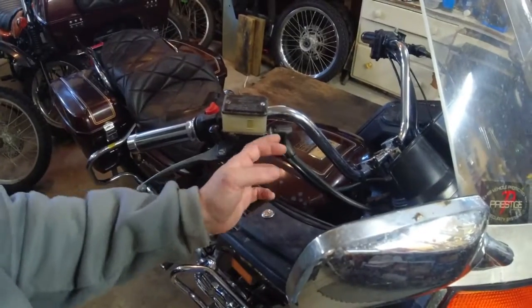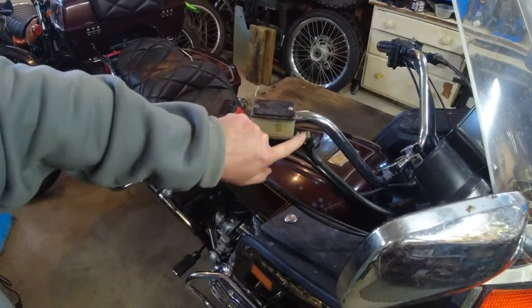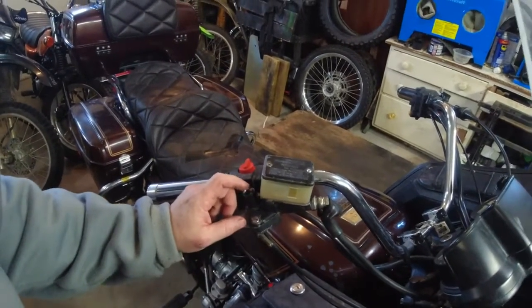Again, I don't know if you guys are gonna be interested in this project, but I was just doing some filming the day when we got the Gold Wing. I did get a test ride on it, but I was able to bleed the front brakes and get them working. Basically the bleeder nipples were corroded, so I used penetrating fluid and some propane heat to loosen them up, get them off, get them cleaned up. Then I had some air trapped in here — that often happens with these things where it's at an angle and you get air bubbles. The master cylinder was corroded too, I had to rebuild it, but it was basically just a clean job.